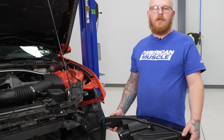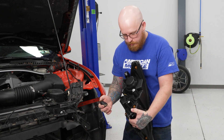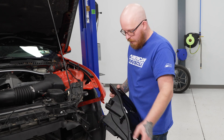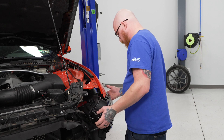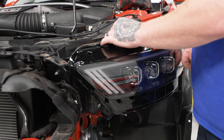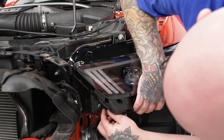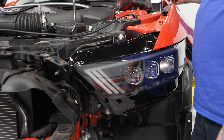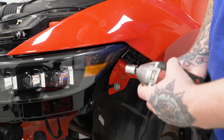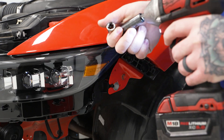Welcome back. Now that we've shown you how to remove your factory setup, we can start installing our new lights. First things first, grab the headlight, grab the factory connector, and plug it right back in as it was from your factory lights. Then set it in place with its locators and get our hardware in to tighten it down. We'll get our two 10-millimeter screws in for the top and bottom mounts, then get the 13-millimeter bolt into the side and tighten everything down. Switch to the 10mm socket and tighten down the two front ones.